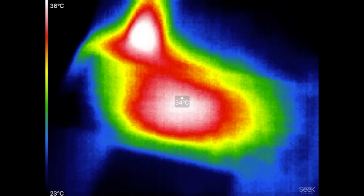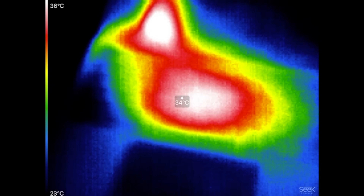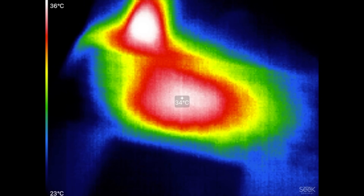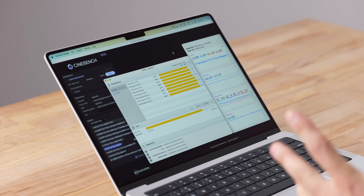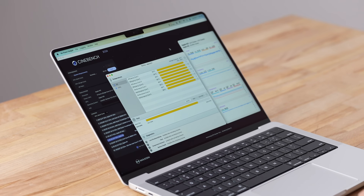If you're running both CPU and GPU simultaneously, like in real-world applications such as Lightroom — which we'll test in tomorrow's video — this might get a little crazy. I pulled out my thermal camera and after about five minutes I'm seeing 35–34°C on the chassis. The chip itself doesn't look crazy hot; we're getting way more heat out of the exhaust, so it is dissipating heat fairly well with the CPU workload. This means we're not going to get chassis throttling, even though we're seeing a little internal throttling. This also means that if you're waiting for an M3 MacBook Air — which is fanless — that is going to have a lot more heat buildup and more throttling, and Apple might even downclock that chip.